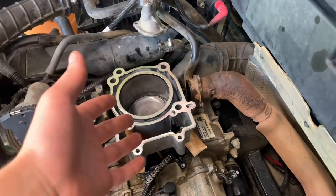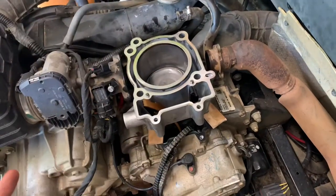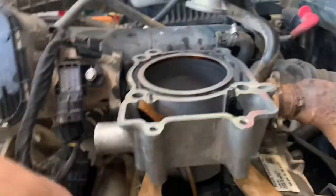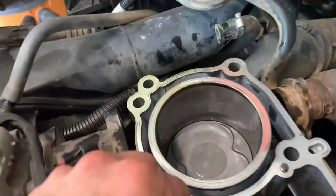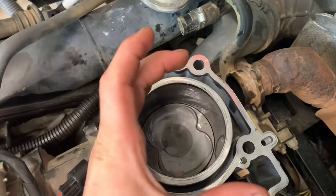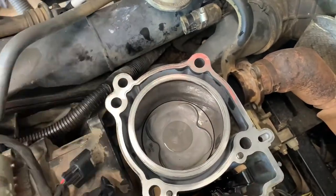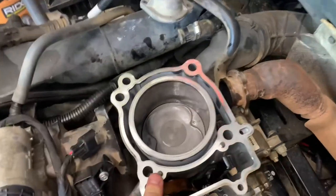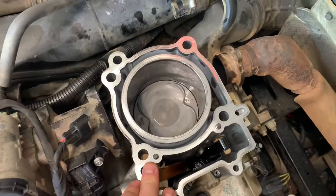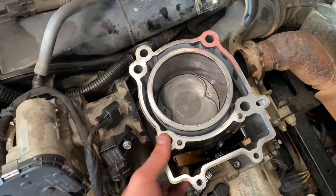I don't have one of those cool clamp ones with me today, so we made the redneck ring compressor, which actually worked perfectly for this job. First I was trying with my fingers and gloves and it was just really hard — not gonna work. So we made the redneck ring compressor and it worked perfectly first try for the two compression rings, the oil rings, and everything. It just slid right on.